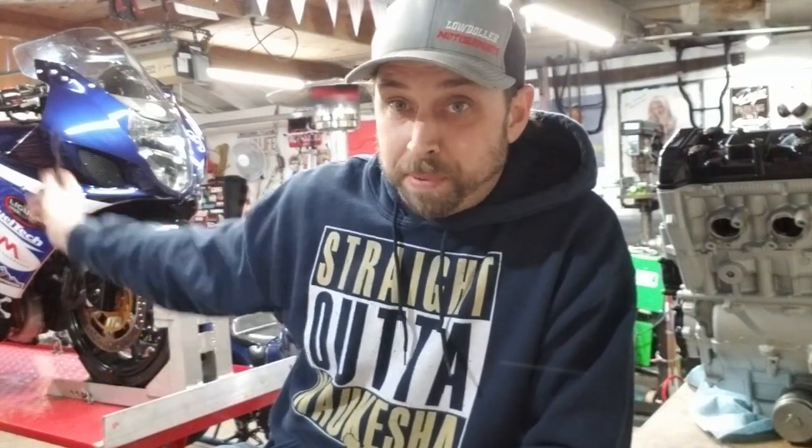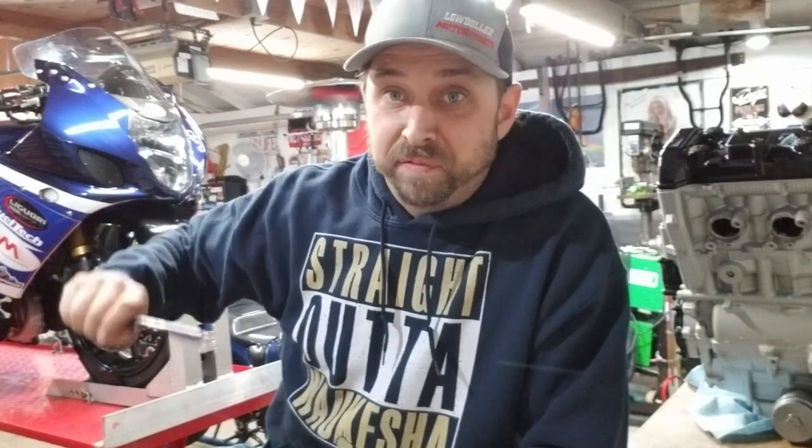I can just put more boost to it and pick up that difference and make it right back to a 750 bike. And it's not going to care. It's got a target air fuel that's going to target the whole pass. It doesn't care what air is out there to do it. If that turbo is pumping it into the motor, it's going to add the fuel and it's going to make the power and make the trip.